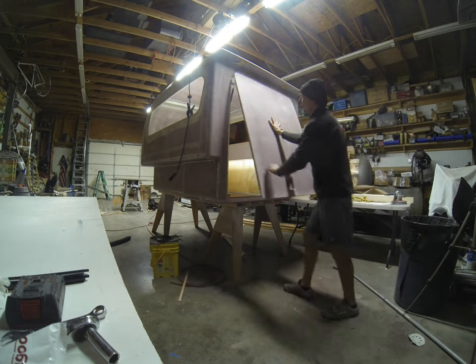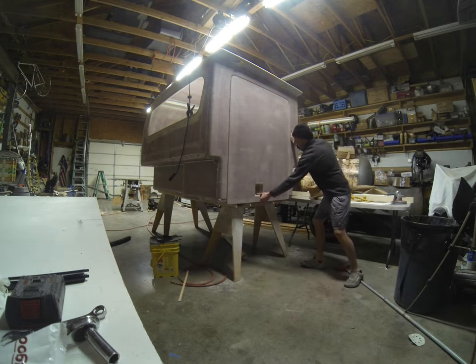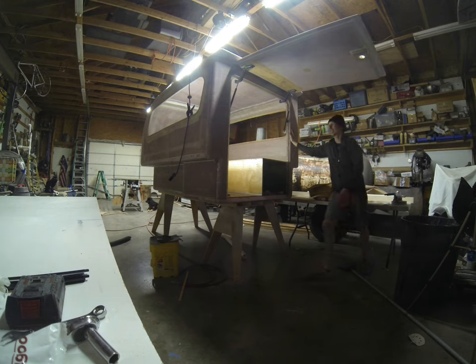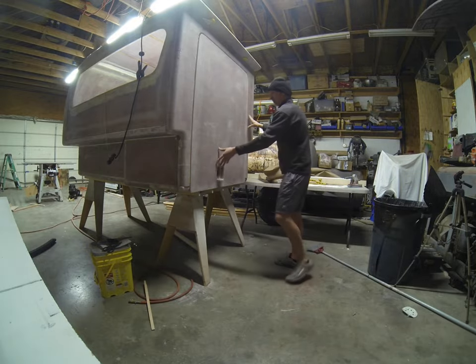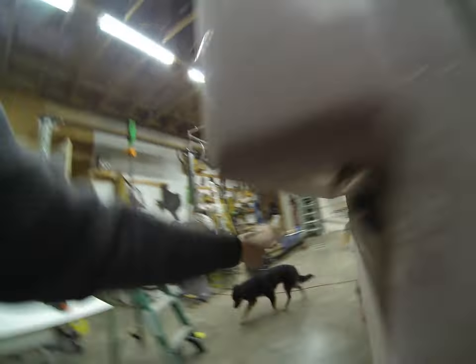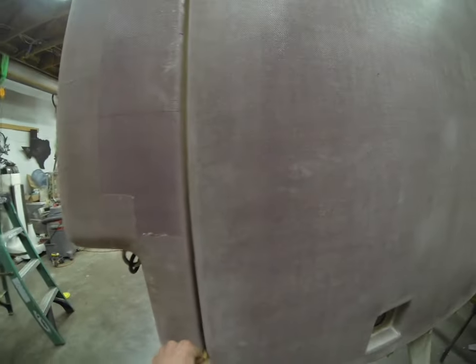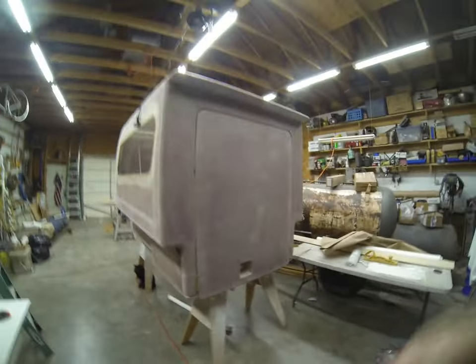I mean it's strong, but there's a lot of wind around here. We're all set up to bond on this rear panel. Our tie-down points are already coming in handy — we've got a ratchet strap running all the way around back to this side, that just gives us a little pressure that way. I've got a couple spacers to kind of fix this door gap a little bit, just tweak it the slightest. I'm gonna mix up some micro now and we'll get this going.